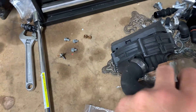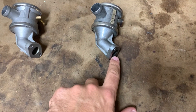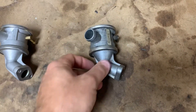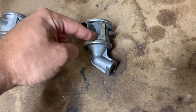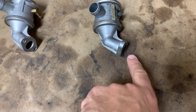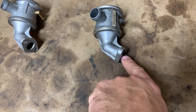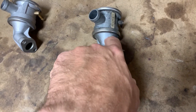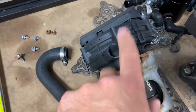From here through this hose into here, and here's your exhaust output through here. The way it works is that air is supposed to travel from the secondary air pump into this inlet and out to the exhaust. However, when the car is running, the exhaust gases are trying to run back this way, and it's supposed to be a check valve that shuts it off and prevents it from coming back into the secondary air pump.